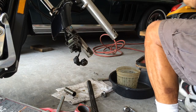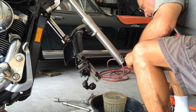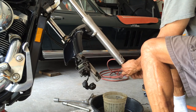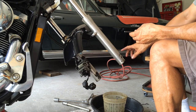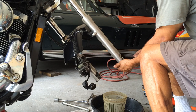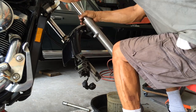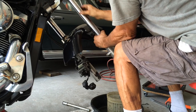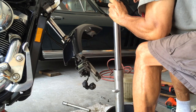I had to put it back in the fender and locked it up and used my impact — it worked swell. It was spinning and that was my problem. This bolt comes right out of this bottom hole — it's up top and it's what connects everything together. Six millimeters. Sometimes it spins; I use my impact and that resolved that problem. I'm going to take it out and put it aside. It's going to leak some oil. Now this will come apart for you — keep this in here, it's going to be leaking. Without a doubt it'll be a little bit of a mess — this stuff is ugly.